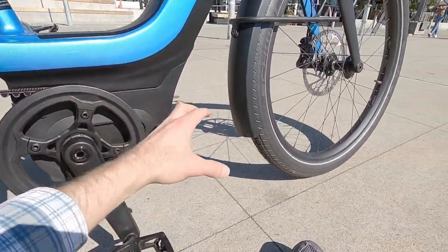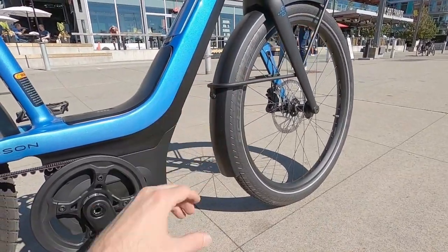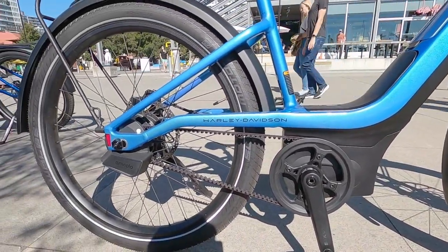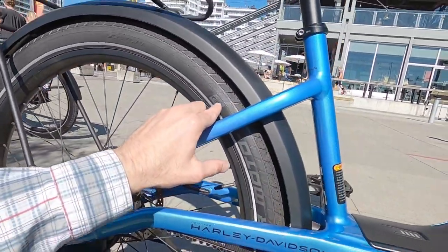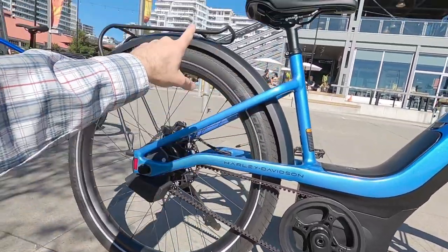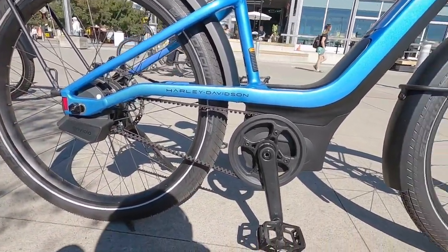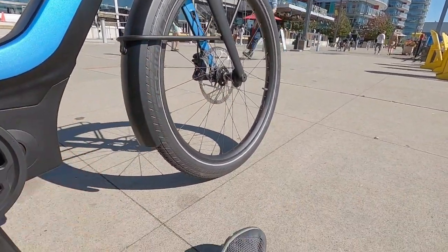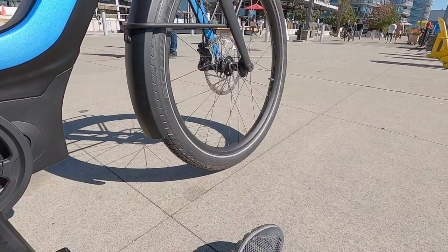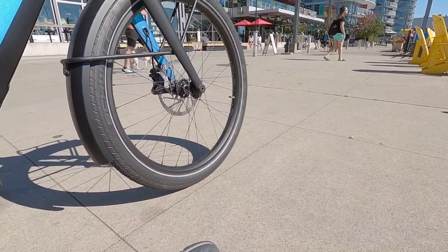In terms of cleanliness, these plastic fenders are extra sturdy and they really wrap around. The wheel size is 27.5, and the tires are Schwalbe Supermoto X with Performance Green Guards, so they have some puncture protection and a reflective sidewall stripe. Boost hub spacing plus size tires gives you additional air volume for comfort, lowers the attack angle, and gives you stability side to side.